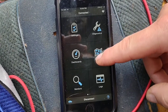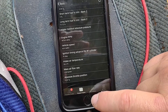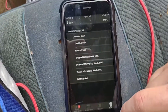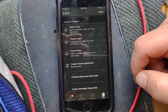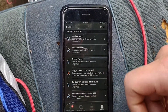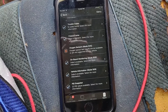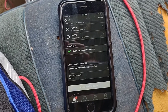I'll go ahead and clear it now. You can also check PID values and run a report, and it will check everything. Mine has an issue with the oxygen sensor, probably because on the LS swap I have only the front two and not the back two, so it might still be looking for the back two. Then clear codes.